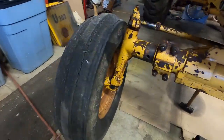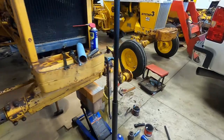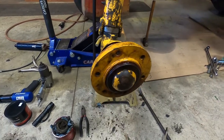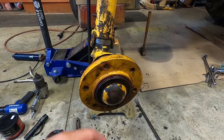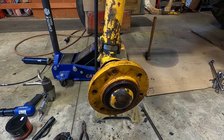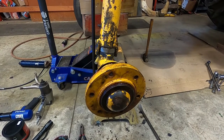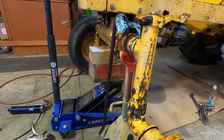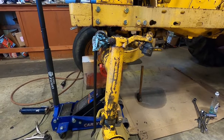Most people run them the opposite way, and it's just a difference in how you space the wheels. But while I had it jacked up and all, I went and got busy - took those off, pulled the cap off, took the bearings out, cleaned the bearings. They were still in okay shape, repacked the bearings, put everything back together. I'm going to do the other side and roll the camera so you can see how I do it. I got to put the tire back on here, shift the jack over to the other side, and then I'll show you how loose that other side is and exactly why I wanted to put the new bushings in.